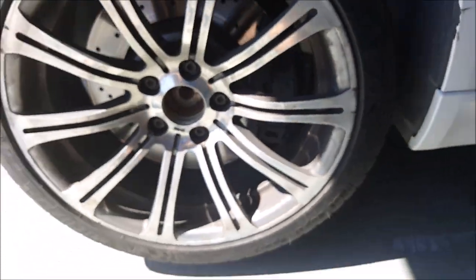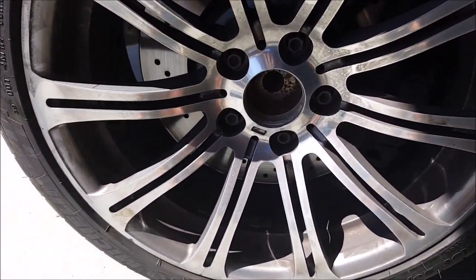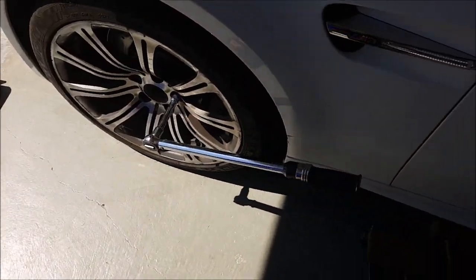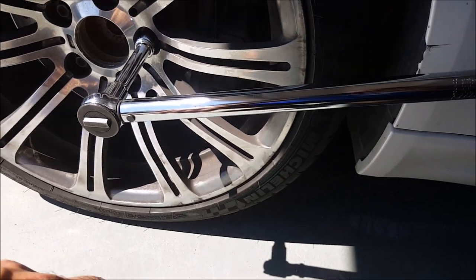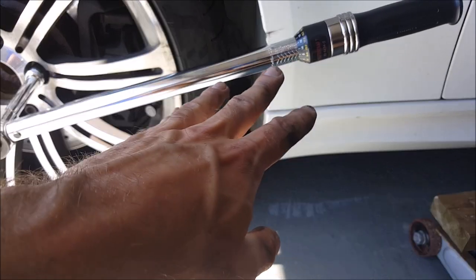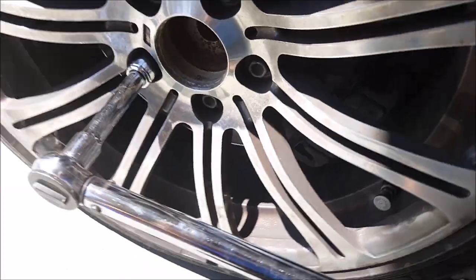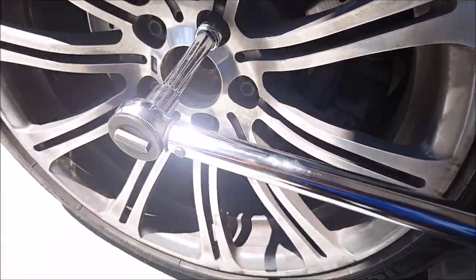That's done. Next step is to lower the car a little bit. I'm going to snug the lug nuts a bit more with the torque wrench, then lower it so the tire is touching the ground — not holding the full weight of the car — and snug them down again. Then last step is to torque them down completely. Get yourself a torque wrench, they're usually about 70 to 80 bucks. I set it to about 82 to 85 foot-pounds. You give it a push down and when you hear the clicking sound, you know you've applied the right amount of torque. Go across in a star pattern to the next position, and that's it.